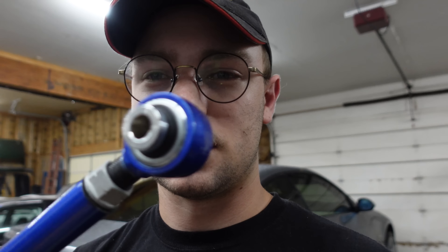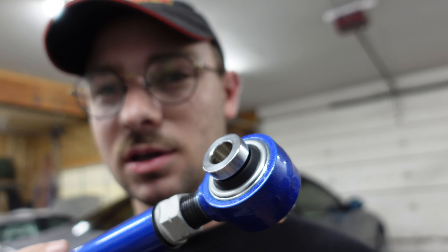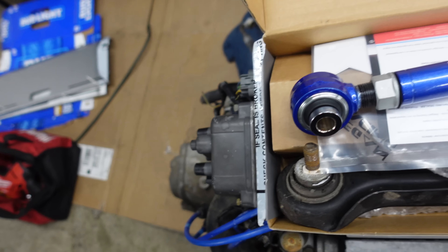It's been three weeks. I ordered new control arms and they finally showed up. I have been carless for two and a half weeks now. Megan Racing was like the only recommended brand I could find that had OEM-style solid spherical end bearing bushings, just like the M3 control arms have, but available for the non-M3. Turnbuckle adjustment, lots of adjustability. This should allow the alignment shop to do as close to a good job as they can.